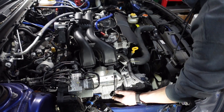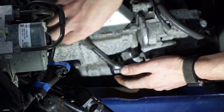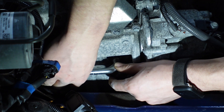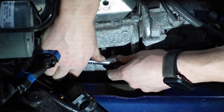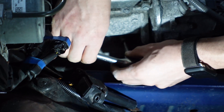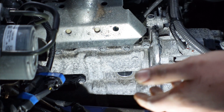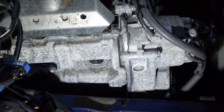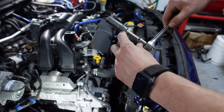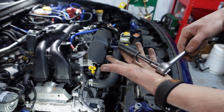I'm going to tighten these by hand just so I can make sure I'm getting the proper torque. You can use a torque wrench if you're really interested in that. They want you to do like a quarter of a turn — I'm feeling like that ended up being about a quarter of a turn. For the front one, just a two-inch extension with a deep 14 and a ratchet, and I was able to get it done even with no spark plug socket.